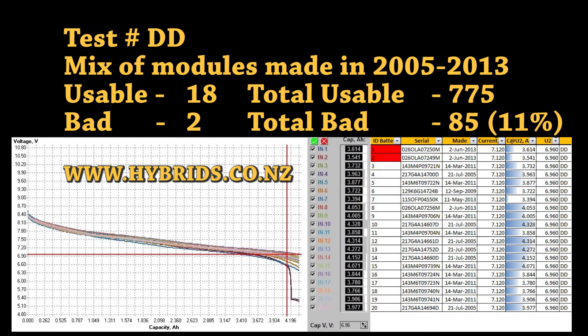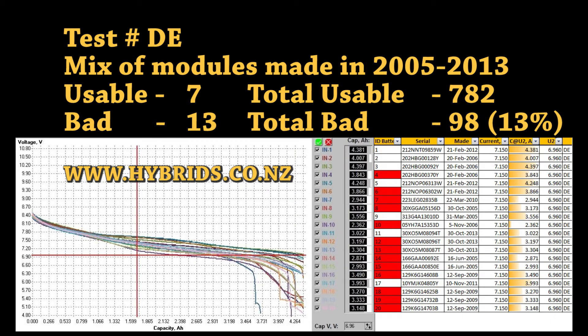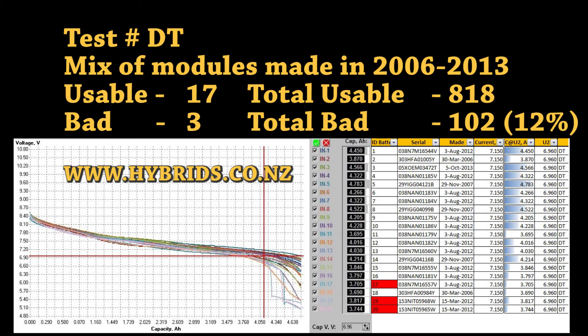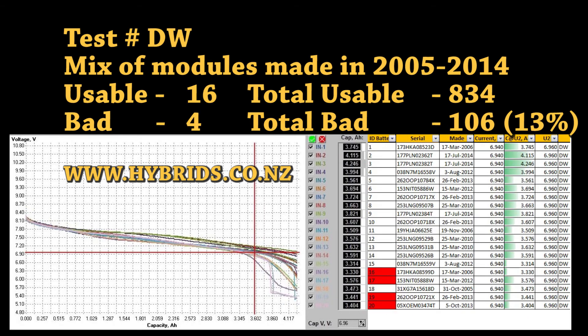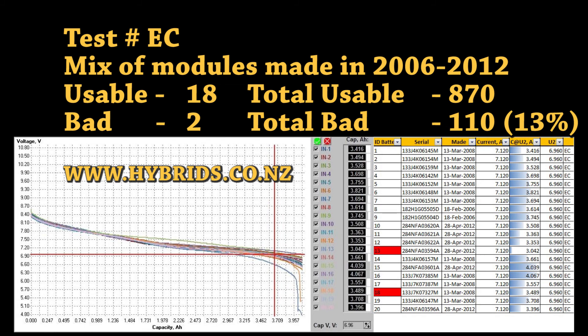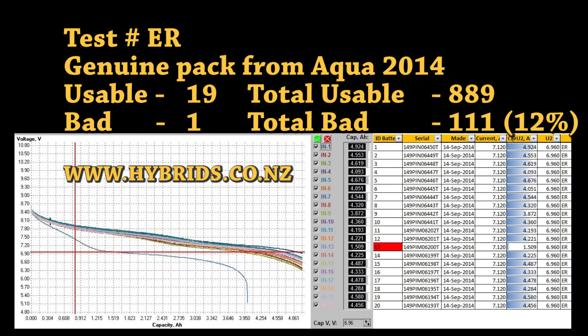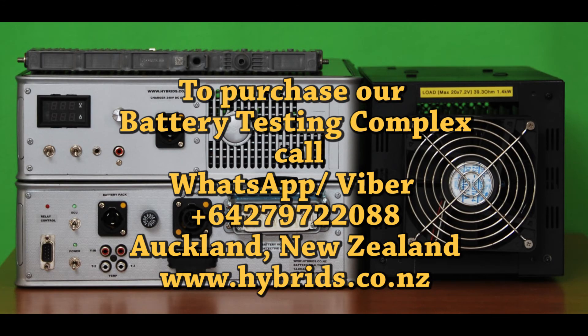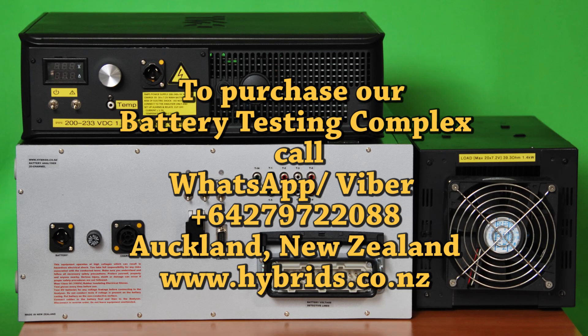There is one popular myth in the industry of battery rebuild: they say only one module is dead, change it and she'll be fine. Usually it's not the case — there was only one such battery pack from a Prius C in these tests. There is more than just one bad module on average. We discarded dead modules before tests even started, but still we are able to discover 12% of bad modules during our comprehensive tests. Unfortunately for DIY people equipped with a multimeter only and/or an RC charger, those failed modules are not easy or even possible to identify. Our battery testing complex is a business out of the box with a fast return on investment — you can start your own battery rebuild business out of your garage or add it to your hybrid repair workshop.